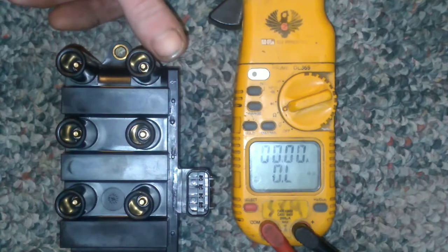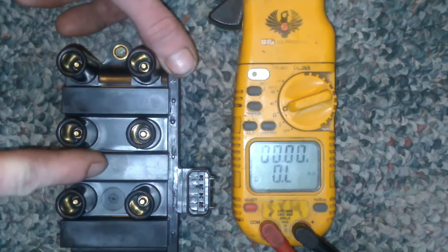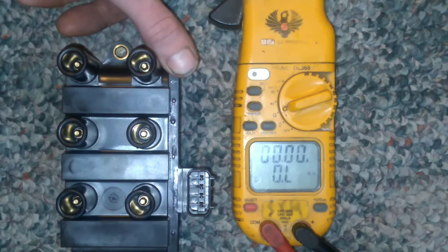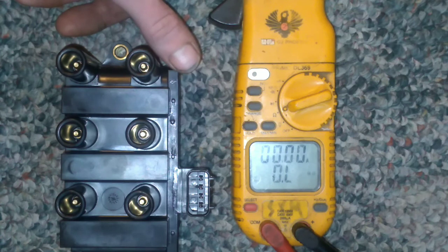This is off a Ford Freestar. Ford has used this coil on the Ford Ranger, the F-150, the Ford Taurus, and numerous other Ford vehicles. There is no ignition control module on the Ford Freestar, as there was with the earlier Windstar models.